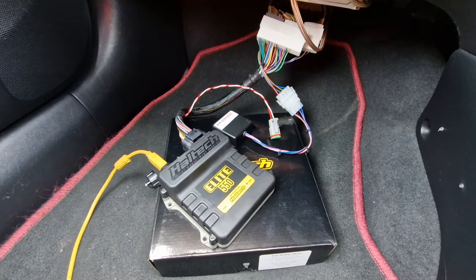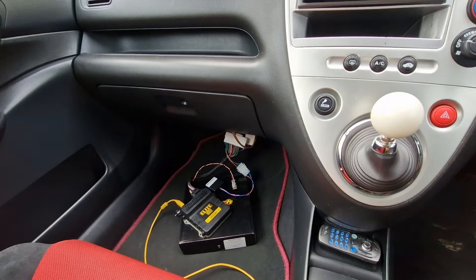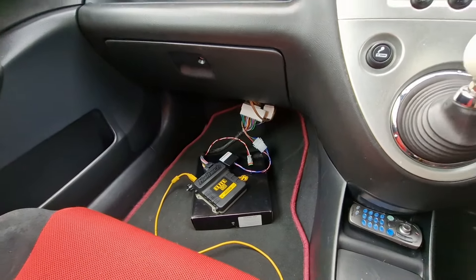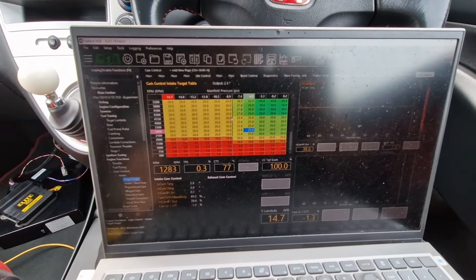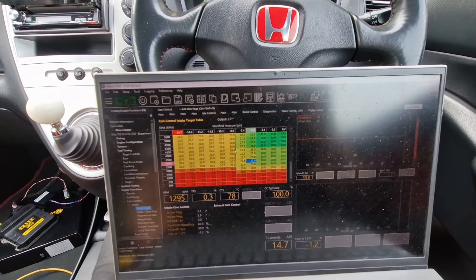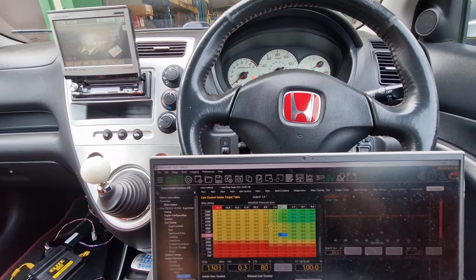Not only that, we've got the CAN expandability with it. If you didn't want to use this dash — this is specifically for people that have stock cars, stock ECU, stock dash, so everything works on it — for people that want to run digital dashes on race cars, CAN pad input, we can run more functionality. We can run IO expanders with more functions. It'll be perfect for race cars. We could probably do things like sequential boxes with the new software coming out for the IC7s. With the race setup on it, we'll be able to do track logging, lap times, and the IC7 will also operate as an expander so we can run extra inputs and outputs straight to the ECU for protections like oil pressure and oil temperature.